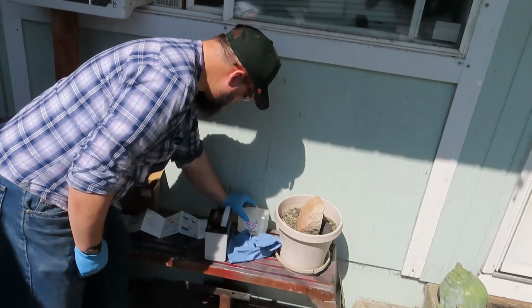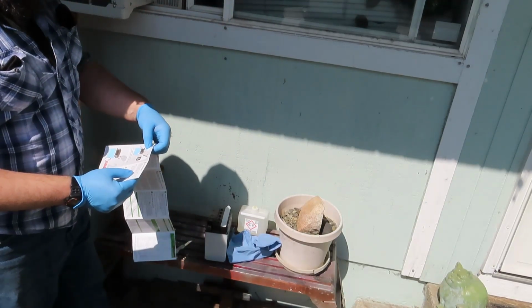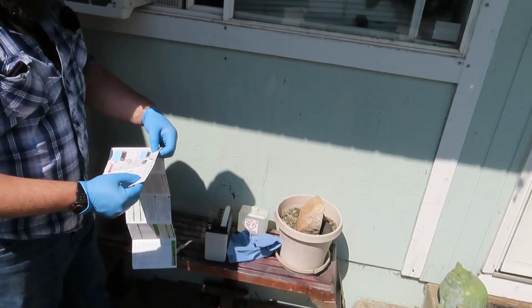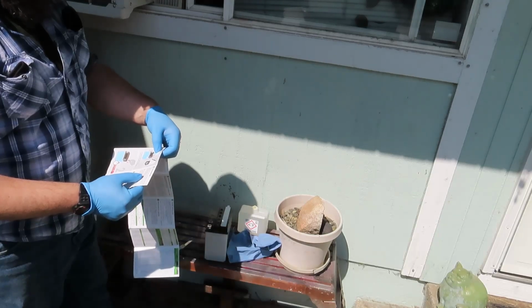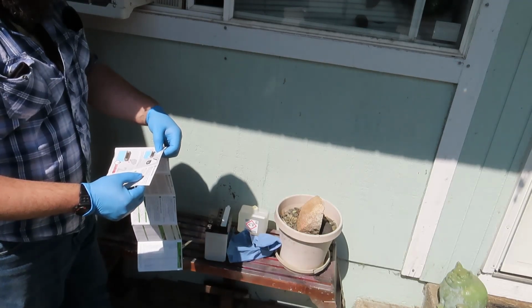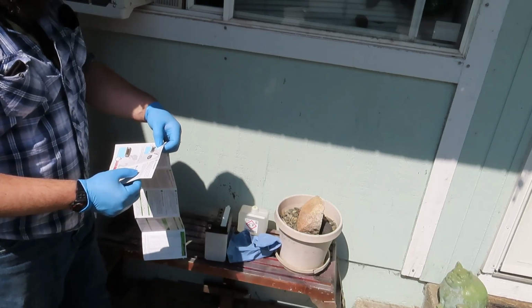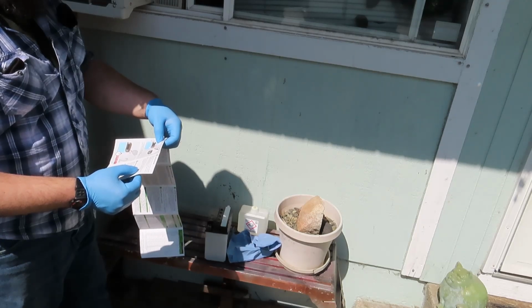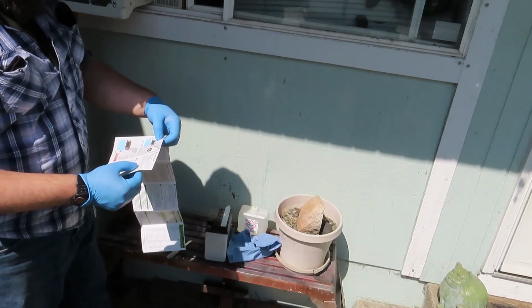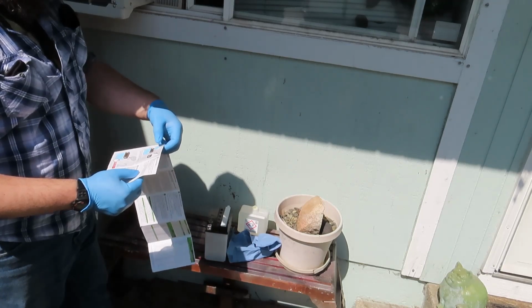Okay, that is opened. Fill battery with acid to upper level A. Let battery stand for 60 minutes before charging. Gently move battery from side to side to release any air bubbles between the plates. If acid level has fallen, refill with acid to upper level. This will be the last time electrolytes should be added. Return unused acid to the place where you purchased the battery or neutralize acid with an equal amount of baking soda.